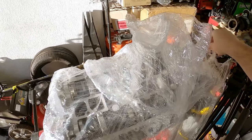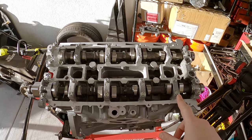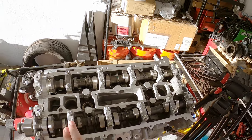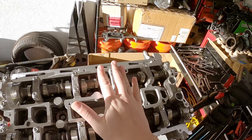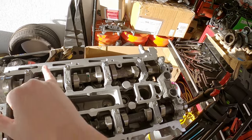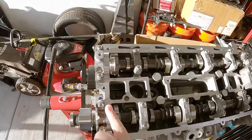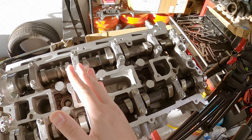Next day, got more work to do. Now it's time we actually get some work done. I left off making sure that all of these cam buckets are right — and they are. So now for the last time, these cams are coming out. I'm cleaning all the surfaces on everything, just where the caps meet on the mating surfaces. I wanted to say mounting surfaces, but that wasn't right. And then I have to put some sealant here — I'll show that in just a second.